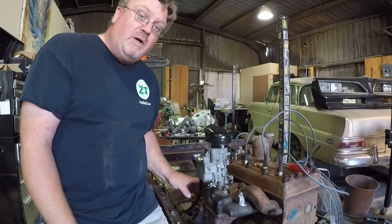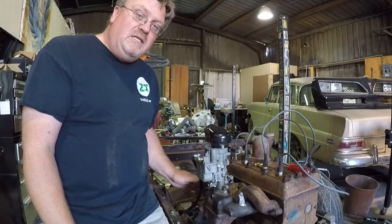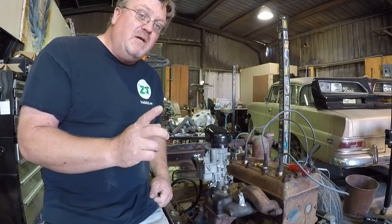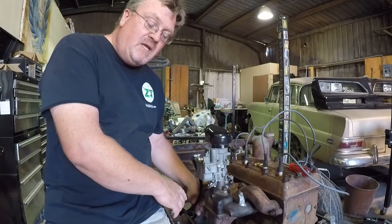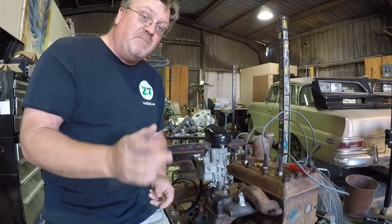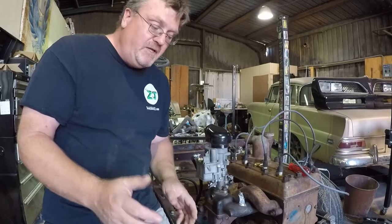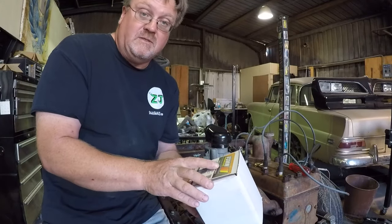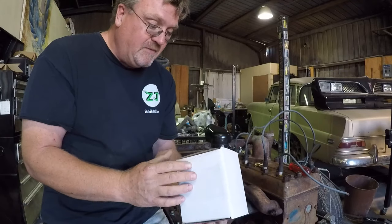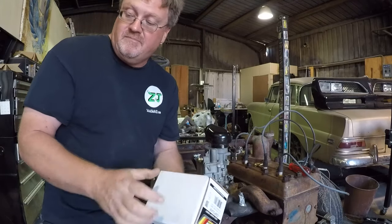My block-off plate on the fuel pump hole wasn't quite working well — I've got oil on the side of the shop wall to show that. So I'm going to need to do something with that. Now I have old fuel pumps, but one thing I've learned is even if an old fuel pump works, it might not be a good idea, because a fuel pump connects directly to the crankcase. If you have a leak in that, you can have a working pump that pumps fuel into your crankcase while the motor runs and you don't even know about it until afterwards. So I wanted to at least rebuild the pump. I was looking at rebuild kits, found one that was pretty cheap for a complete unit — it is from US Motorworks. US technology, made in China. But it wasn't much more than the cost of a rebuild kit, so I'm going to try it. One other thing: this motor mount can be an issue when you go to put your fuel pump in — your fittings are right up against it. Make sure you add your fittings first before you bolt the pump in.